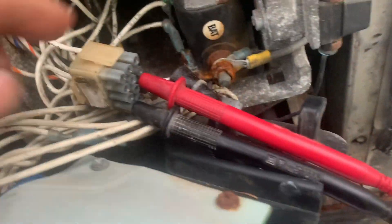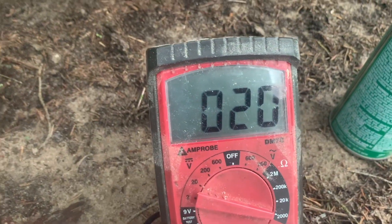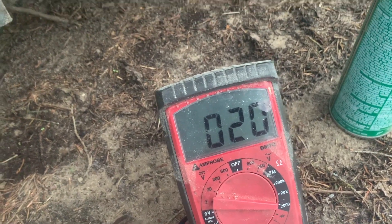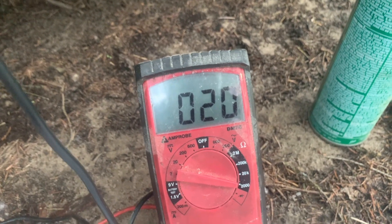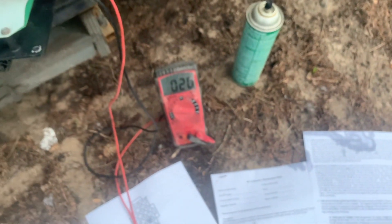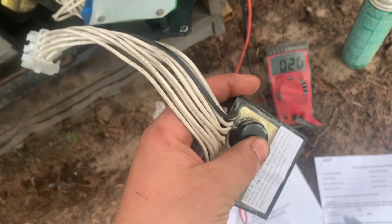Now the other measurement is on pins 9 and 10, which is supposed to be between 20 and 30 ohms — I'm at 20 right now. Initially it was at 30, but I spun it over a little and tried to clean the slip rings. They're a little shinier now and reading a much better ohm measurement. I think we're actually in pretty good shape. What probably happened is my slip rings got too dirty and burned out the voltage regulator — it just keeps having to work harder and harder until it overheats and kills itself.